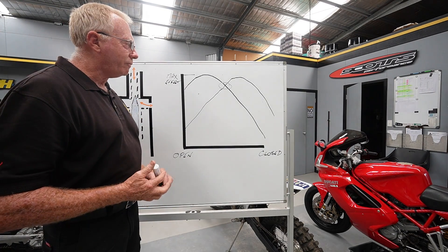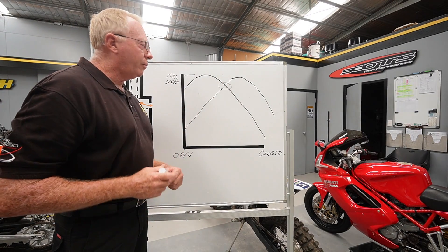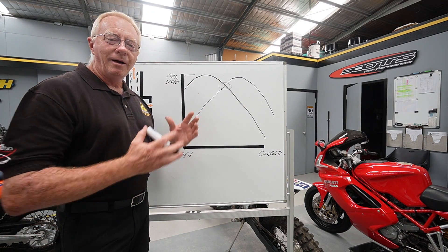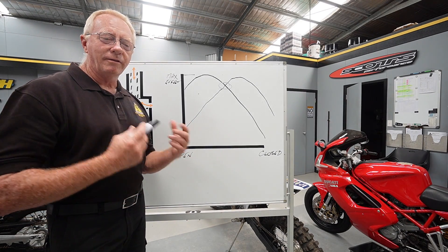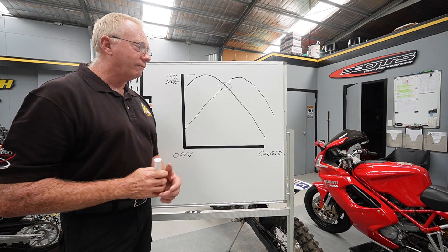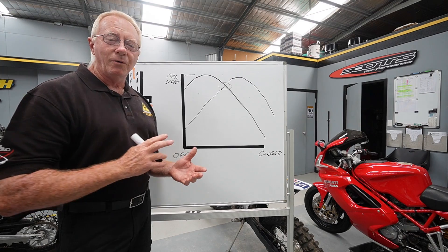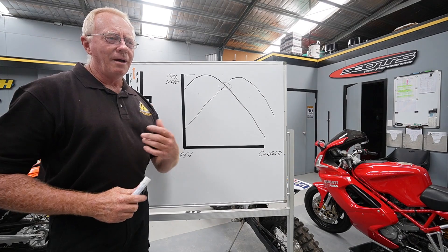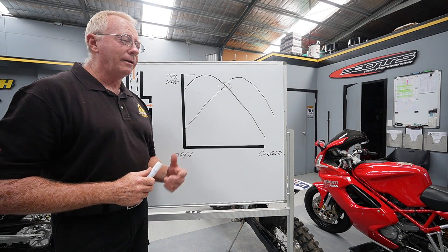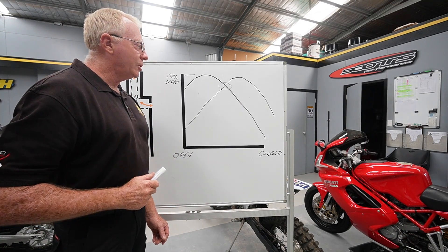Prior to having what we call a rebound separation valve, we would aim to be somewhere in between — getting a high level of traction and a high level of control — but as you can see, we end up with a compromise and we're not getting the best of either situation. Paul Thede from RaceTech runs training seminars, and I was attending one when he pointed all this out, which was quite illuminating. That got me thinking — is there a way to get both traction and control to peak together with the rebound adjuster? That's when I thought: let's use a rebound separation valve to create different values on the compression phase versus the rebound phase and hopefully optimize both. We got a very positive result — it gave a more stable motorcycle, more grip, allowed you to get on the gas harder out of corner exits, maintain a tighter line, and off the start line it could be worth one to one-and-a-half bike lengths.